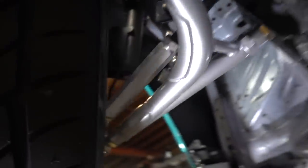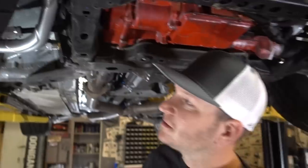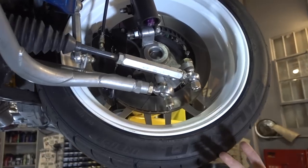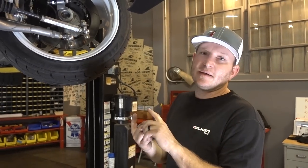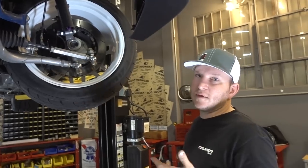Look at that cut-out — that's so the wheel can fit back in there, because it's gonna lock so hard you have to be able to fit the wheel back in. I have this drop-down just for tie rod clearance so at full droop or full bump there's no interference. It's a kind of weird setup because factory this car is a dual lower control arm — a dual lower pivot point, kind of like a BMW. But that doesn't work well for drifting, because when you have two pivot points you're going to get into bind. So I went to a single lower pivot and designed this to work with that.